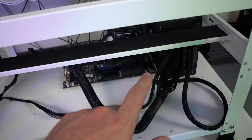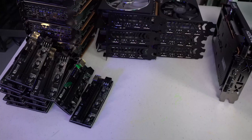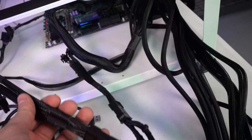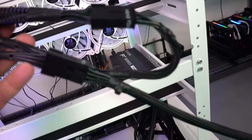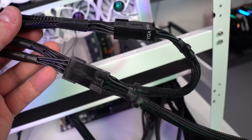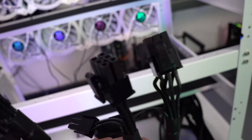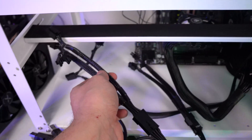I need to get all the power cables put into the power supply, so I'm going to do that now. We have a single 8-pin from the power supply branched off to two 8-pins, and both of those are connected to our 18 AWG splitters with the two-pin tab pulled out, giving us a total of four 6-pins to power four risers.